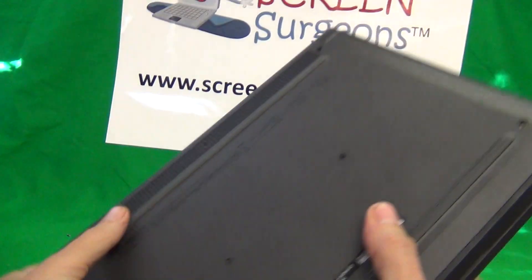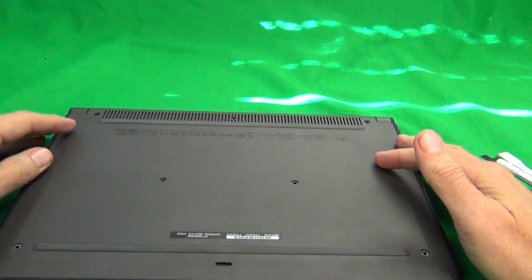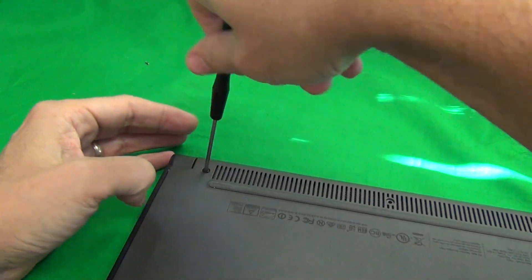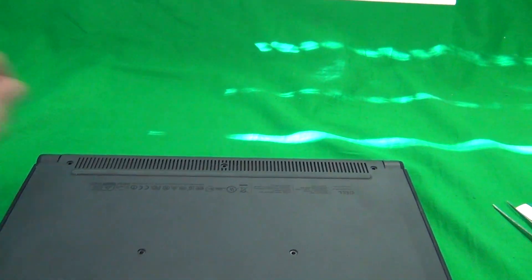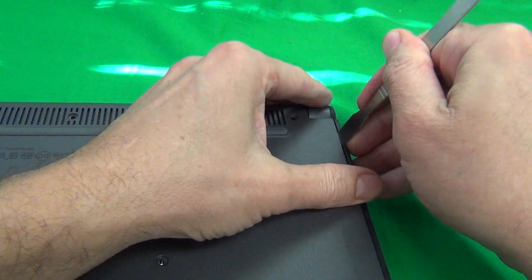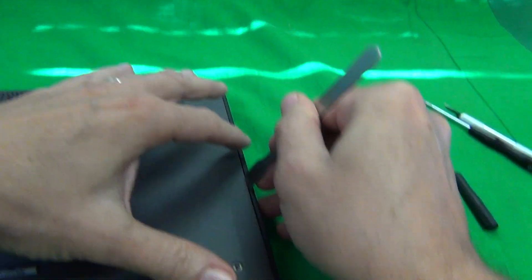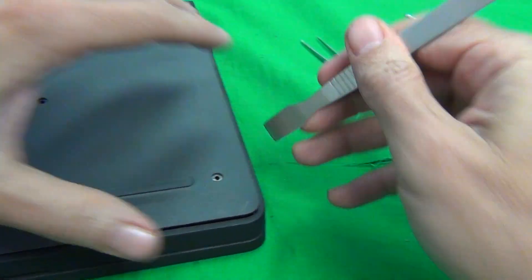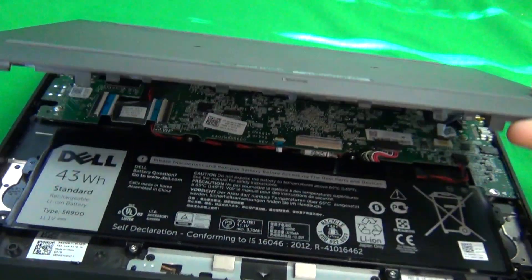So we close the laptop, and we have to undo the bottom cover. It has a total of seven screws that you have to remove, and we use our PH1 screwdriver. I already removed six of them, so there's only one left for me to remove. Then we pry the back cover open — that's where our metal spudger tool comes in handy. Find a gap in the seam between the rubber part and the plastic back lid part, and just go around the bottom lid. Sometimes it's quick, sometimes it's not, but it comes off.